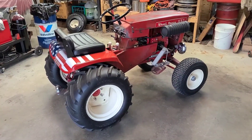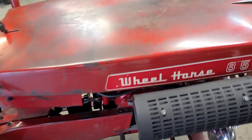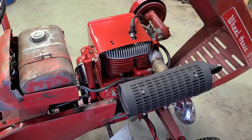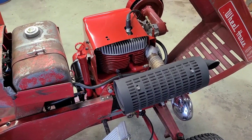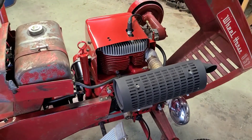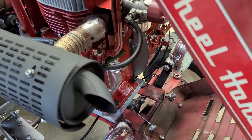Let me run through what I've done thus far. I've gone ahead and greased all the points in the front end. I did go ahead and change the oil in the motor - just changed it with straight 30 weight. I use the VRF Valvoline race oil because it's got those extra zinc additives for the flat tappet cam. This engine takes about a quart and three quarters with the small oil pan. It is a little bit overfilled and every once in a while it'll blow a little oil out of the valve gallery or through the breather.